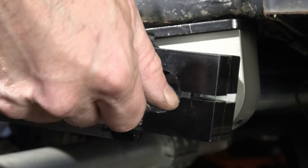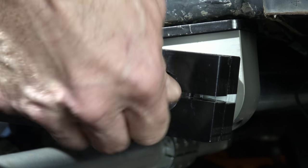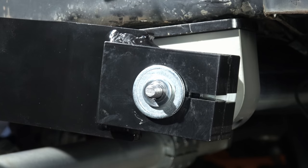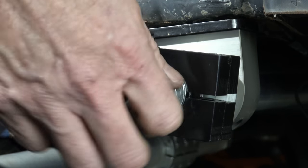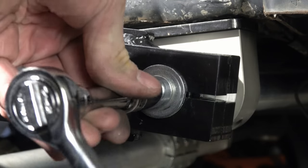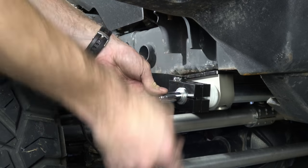Now that I know that my spacers are right, I can continue to tighten everything down. If you run into some issues, you might try sliding things around with those spacers. Now I'm using the installation tool to tighten everything down and get those arms pressed onto the torsion bars. There's that little stud that goes in the middle of the torsion bar, then I'm going to add the heavy washer and then use the nut to tighten it down. You want to make sure the torsion bar is aligned with the arm, and that V shape has to be lined up as you're tightening things down.